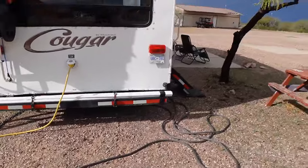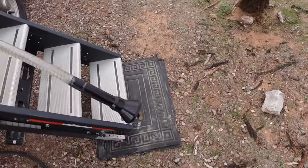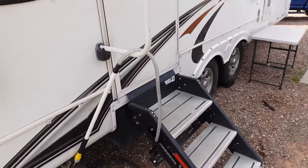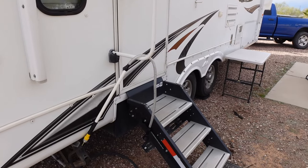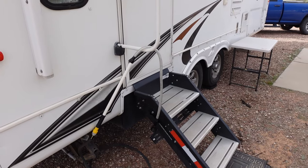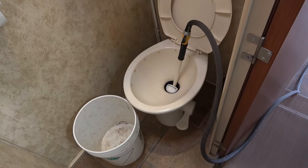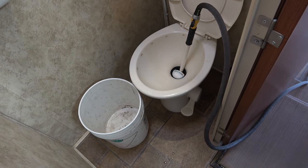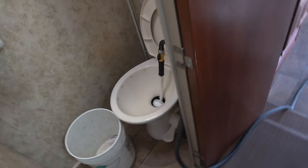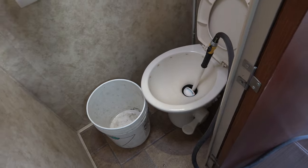I just hooked up a hose to the water and I've got one of these wands I can put down the toilet — they spin at high velocity to flush out the black tank. I'm also going to pull out the drain in the gray tank and stick a water heater wand in there to flush that as well. I've got the wand jammed down the toilet into the black tank and I usually just let it go, keep a bucket handy. After I'm finished I'll get a bucket of water, put a little bleach in it, and let it sit to decontaminate.